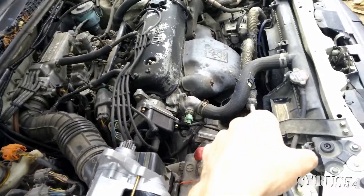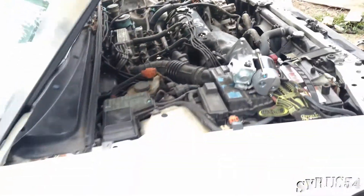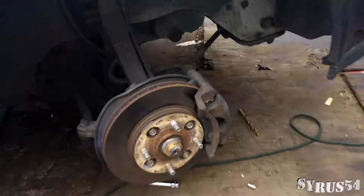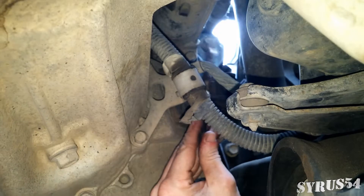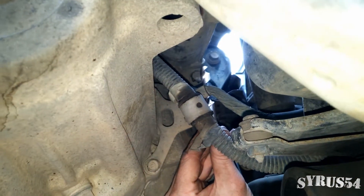In the event that the 17mm on the bottom of the starter is just too hard to get off, what we're going to do is jack it up, take off the tire, and get to that from the underside. Looking at the front of the vehicle, we have the brake here, coming inward, you see the trans-axle, and looking up — right there at the end of the drill is the bolt.